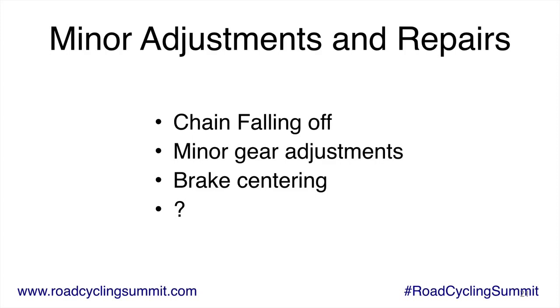So you would want to unscrew that little knob. Now, when I say unscrew it, I'm saying like 1/8 of a turn at a time, which is a very small adjustment. So you say your gears are clanking, you unscrew that just a teeny bit, try your gears again, do it a teeny bit again. And if you don't get it within a quarter turn or maybe a half a turn, most likely there's something else going on. But if your gears were working fine and then suddenly they're not working fine, it's probably because the cable's stretched and you're just going to unscrew that screw.